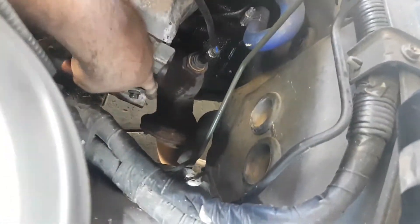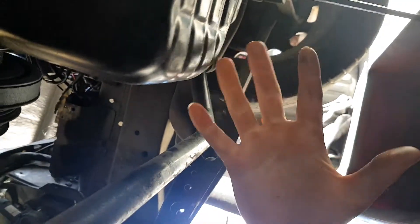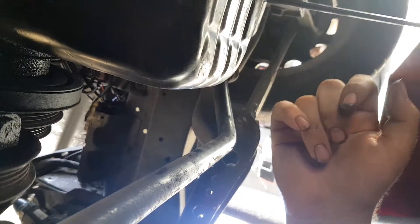So in trying to get the elbow here off, this was hooked under — like that, underneath this. This is what secures it to the elbow; I just had to take these out — these were 3/8s. So, a bit annoying, but yeah. Alright, so we're under the car here, and that's a drop oil drain plug — that was a 14mm. Now I'm just going to undo that and let the oil drain. Perfect — didn't even get dirty. So, yeah, let that drain and then we'll go back there and do the tranny. And then that's all the fluids drained — then we're good to go.